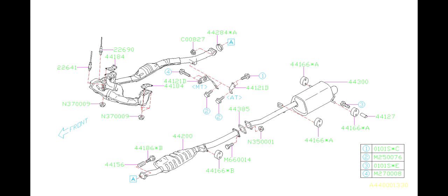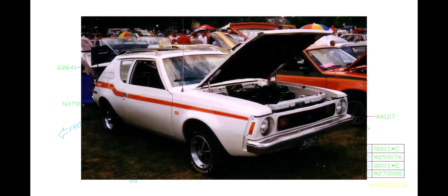And incidentally, that's a really simple way to diagnose which catalytic converter is failing. If you remove the downstream oxygen sensor and your car's performance improves drastically, then it's going to be your downstream catalytic converter. But if nothing changes, then it's most likely going to be your primary catalytic converter in your exhaust manifold. And that's about it. I have a bunch of other videos about this topic I'll link to below, and enjoy not getting your ass handed to you by an AMC Gremlin in the drag race.